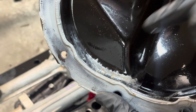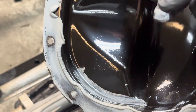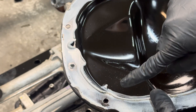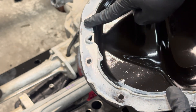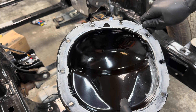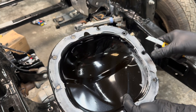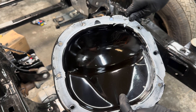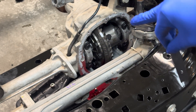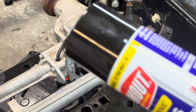As you can see there's a lot of crud and gunk, which is why I'm changing mine. With the brake cleaner, this will clean things out. Get a flat razor and clean up all the edges — make sure you don't scratch any of it, as well as the front diff itself. Make a couple of passes to clean up all the extra RTV. That way it sits nice and flush when you put on the new RTV. Go around the front diff and clean up the RTV until you're good for the next step.